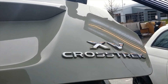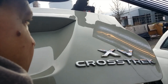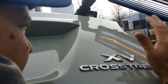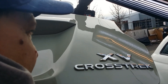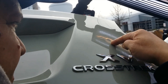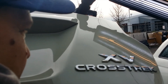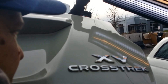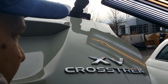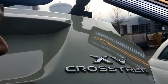Now I'm up on the top edge here. I've got this little triangle where the line gets high, rolls around this edge of the dent and around the top edge — we call that an eyebrow. There's the eye of the dent right there. I don't necessarily want to go right into that eye; I want to come around the outside of this eyebrow and bring it up. When you switch from tapping to pushing and pushing to tapping is a point of preference, but I've always been under the impression that the second you see something that's too high, you want to tap it down — because you can't get the lows out until the highs are down.